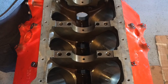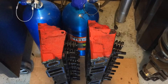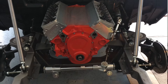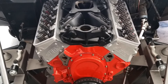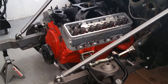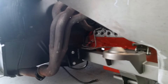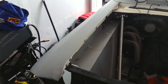As this engine ran, it was basically leaking oil into the combustion chamber and onto the top of the piston — basically shortening the life of the engine. So those cylinder heads are getting thrown in the garbage and we decided on a JEGS brand aluminum out-of-the-box bolt-on cylinder head. We went with JEGS because their flow numbers are really good, and the valve springs available fully assembled will work with the cam we have — the spring rates are all within range. It flowed really well up to 600 thousandths of an inch lift, so with our cam at around 550-560, we're in a good spot and won't be putting that cam in a cylinder head combination that can't handle it.